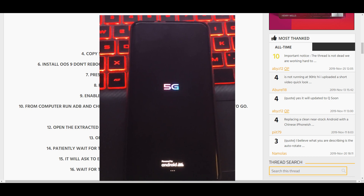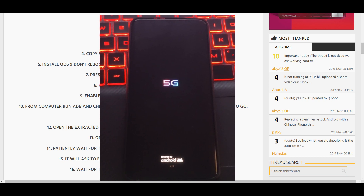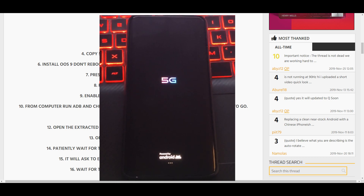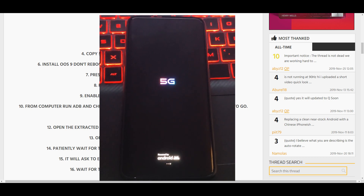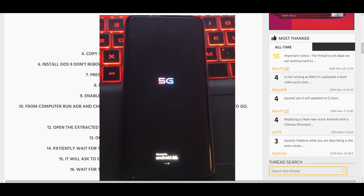That took over ten minutes — if you're sitting waiting and it looks like it froze, it did freeze. All I did was hold the Power button and Volume Up together to reboot. Once you reboot, it looks like it's now actually loading. So remember: on the first boot, if it looks like it froze, give it some time, but don't panic — just reboot the phone if it doesn't boot into the ROM itself.